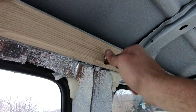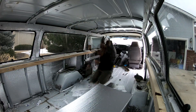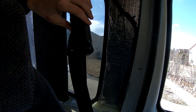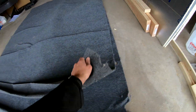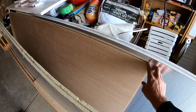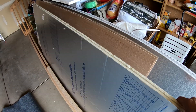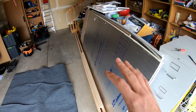You really can't over-insulate a van, so here I am adding more insulation. I ended up covering up the back window, but I left a gap open so I can still check my blind spot when driving — just for safety. Next is the floor insulation: a little bit of felt fabric for sound dampening and a little insulation, then half an inch of foam insulation for an R-value of 2.7, plus a subfloor. I'm a little worried it's too thin, but I'm trying to cut down on weight. That'll be three layers of floor, and on top of that the actual flooring — four layers total.